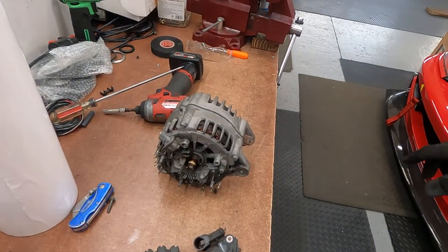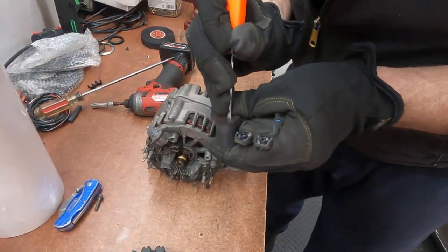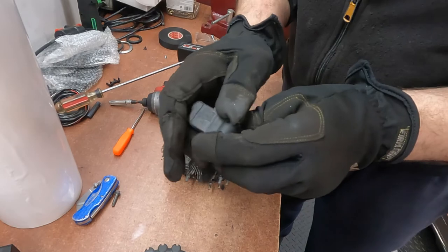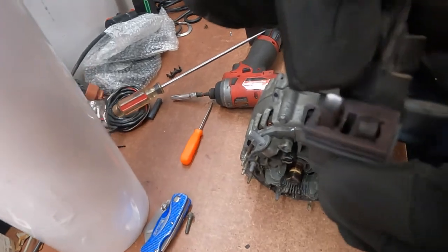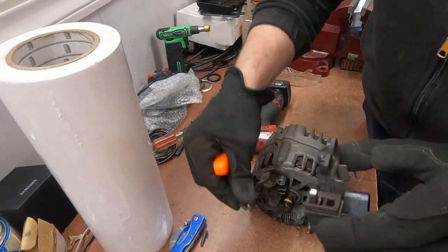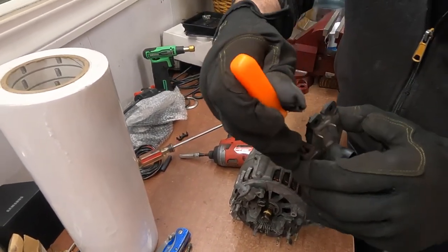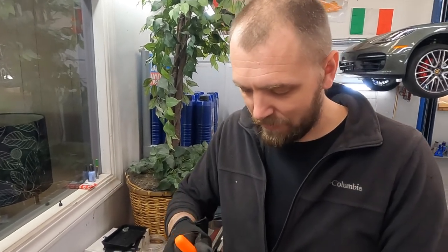Give me a few. Let me grab this. Oh, no, actually, over there. I will show you what happens. This is plastic. This is nothing dangerous because we installed the new brushes and we replaced that one. See, this one is glass, that one is matte, and you see the brushes came off because the rotor hits the brushes all the time and damages them. It's like when you twist a wire all the time like this, it breaks in half, right? Exactly the same thing happens with the brushes.